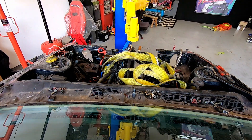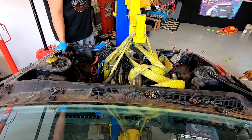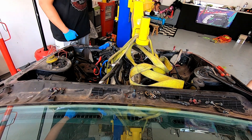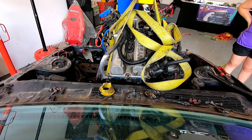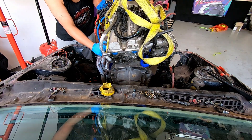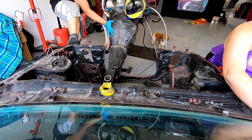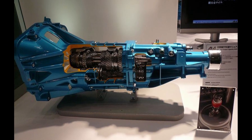After much deliberation I finally settled on a gearbox for project wonder. I had a few criteria I wanted to check off before pulling the trigger and laying down some coin. Before I would know if the damn thing would actually fit: one, it had to be of Toyota heritage; two, it had to have readily available upgrade parts to handle the power and drivetrain shock I'll be giving it; three, it had to be a remote shift so I could place the shifter in any position; and four, it had to have a reverse-mount starter motor since there's no recess in the block for a starter motor in the 2AZ.